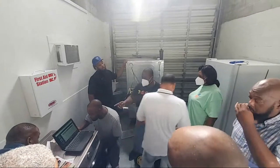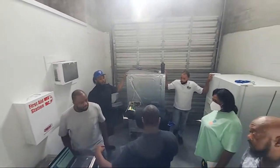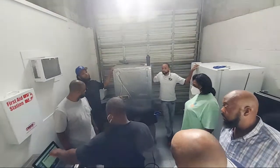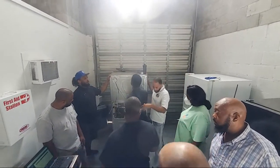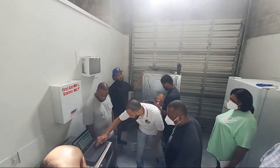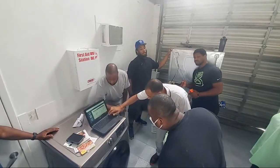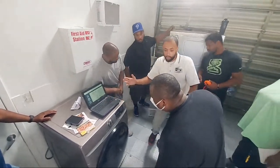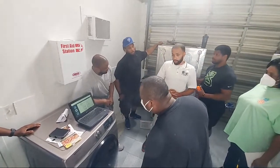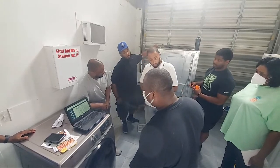Now another question. Sure. Like when you was finding the neutral, right? Is there any reason why you chose, can you explain why I chose that particular neutral? Because look, how many components you see here? Defrost heater, water valve, fans. They need a neutral too, but they tap into that main neutral. Okay. That board needs a neutral too.